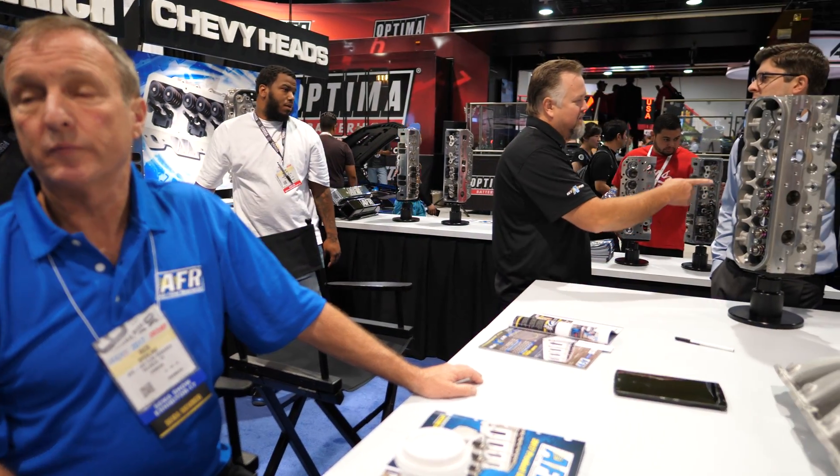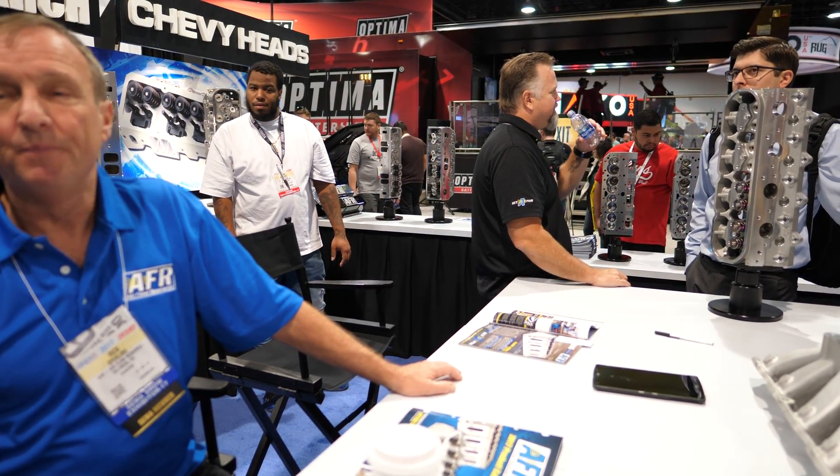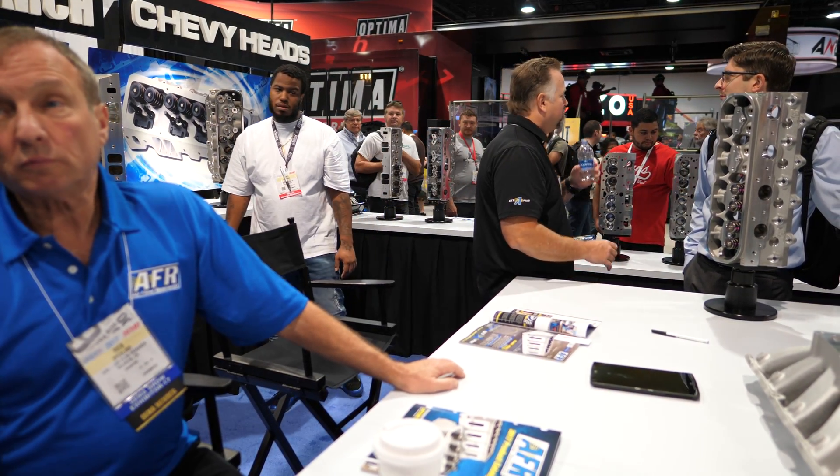I think Camaro, Corvette, and some trucks have it too. With that direct injection, that's probably going to be a big challenge. They say you don't really change the combustion chamber shape or designs, but some people are. There's a lot of R&D on that one. I think eventually you'll see that happen — the diesels have been using it forever. I wonder if with those injectors you could use the ones diesels are using. We haven't gotten into that yet. Once you max out the stock injector you've got to get different ones, and I know they're really expensive, high-precision stuff.